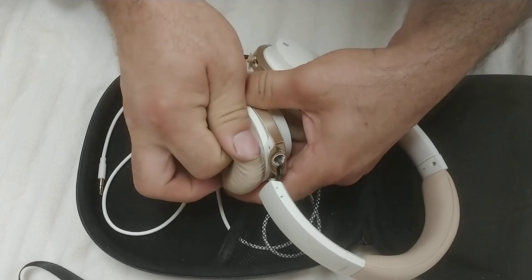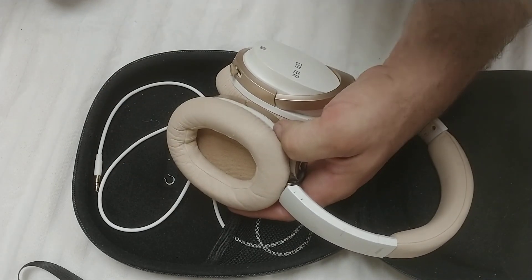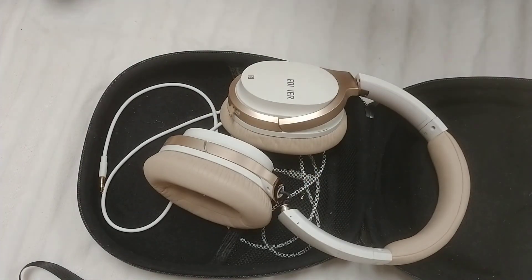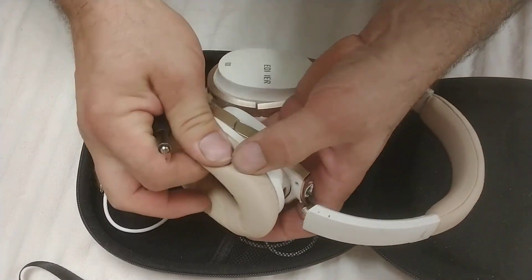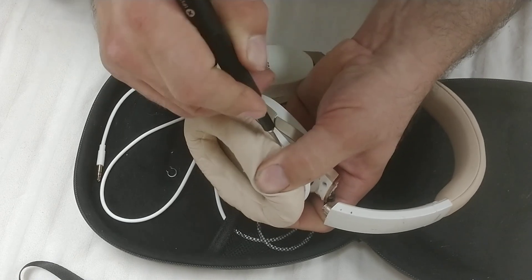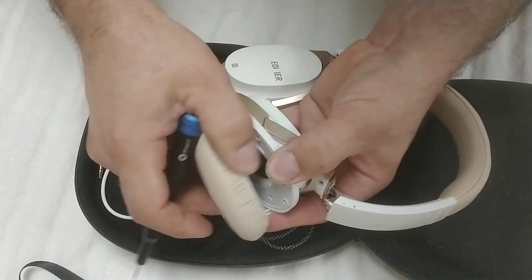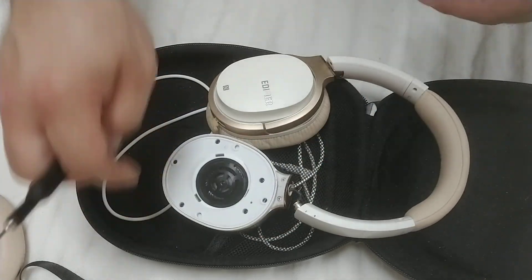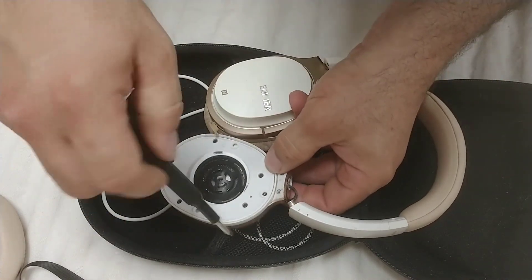There are two. Right here is the separation. You kind of jimmy it apart by using a thin flathead screwdriver or a guitar pick. I am going to use the thin flathead screwdriver. Once I get that off, then there are four Phillips screws — you'll need a Phillips 1 for these screws.